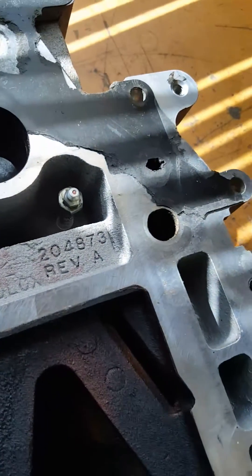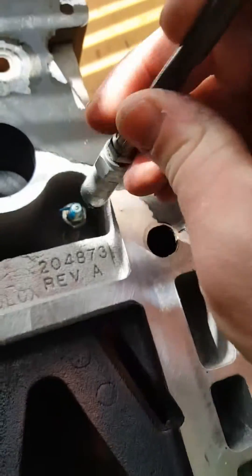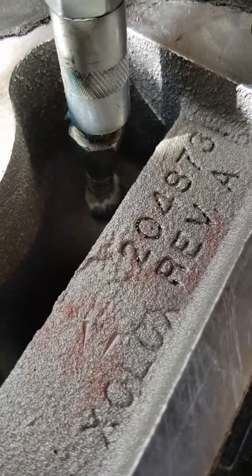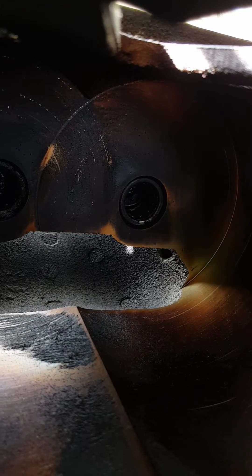Go down until it touches. Then you get a grease gun — it's a huge waste of grease, but it works. What you do is just start pumping. The reason why you put tape or pipe dope around that bolt is you'll start seeing the grease come up around it like that — that's what you want. We're going to do this right one over here.